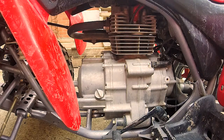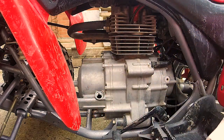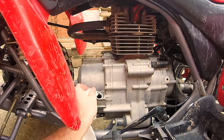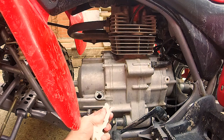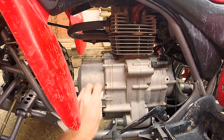Now it's time to add the new oil. I'm going to take out the dipstick here — there's also the fill point. Just take out the little dipstick; obviously there's a little bit of oil left on it, just wipe that off and set it aside. I wiped off the area around the hole before opening up the dipstick, but we're going to make sure again that it's really clean and wipe away any dirt that might be there. This is an ATV, so you're going to get dirt in lots of different places, so just want to wipe that away from the hole so nothing falls in while we're filling it with clean oil.